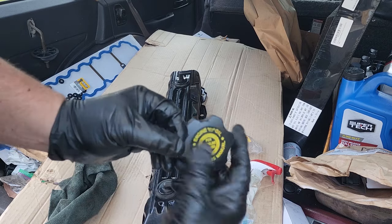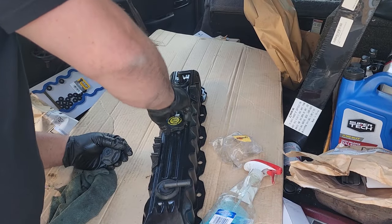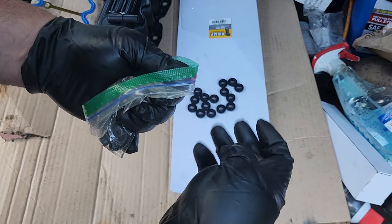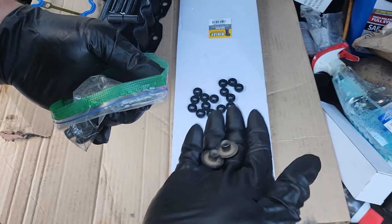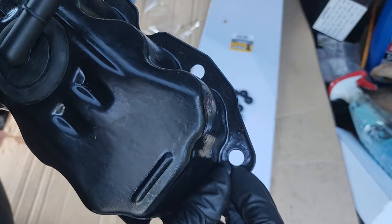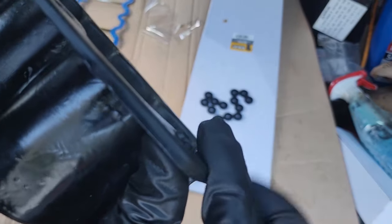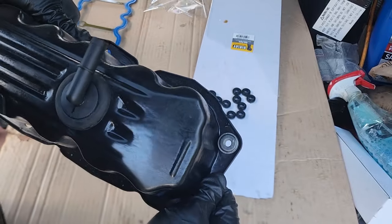There we go, right out to the driver's side. We'll lube this one up too - very nice. We can revisit our little cable holders - clips right on. And a nice factory oil cap, I have an aftermarket one too, we'll go with the factory. Got 15 new grommets - these came with the valve cover set. This set I cleaned up earlier, soaking in degreaser and then tumbled them for a day, so they're ready to go. You just slide the flat end in like so, and this end with these little feet clips right into the valve cover. Insert them into the valve cover - they just pop in. Make sure these little feet come through - you'll know it's in because it doesn't fall out. Then you can reinsert your factory hardware, and that holds them in place. Do that 14 more times.